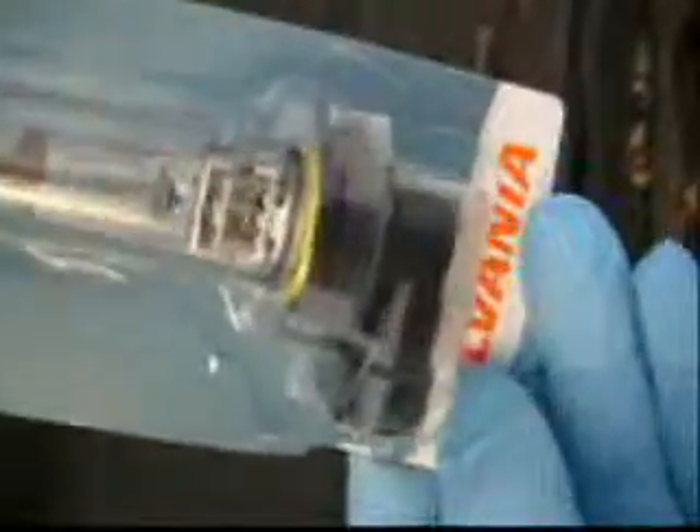With a little patience we got it out. Now this is the new bulb — you'll notice I have gloves on. When installing these bulbs you want to make sure you don't touch the glass; the oil from your hand can cause this bulb to burn out a lot quicker than normal. Also when installing this, try to keep it from touching any part of the frame that might have grease on it.